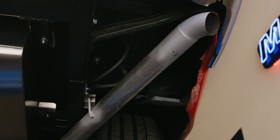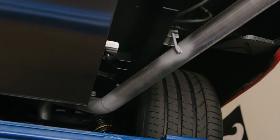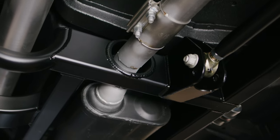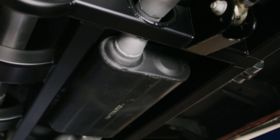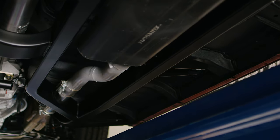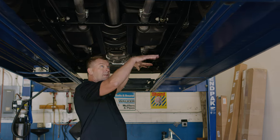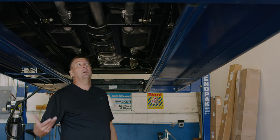During the conversion, putting the body on, we had to build a new exhaust system, and if you look underneath you can see how the exhaust is nicely routed — it goes right through our frame rails. The exhaust systems in these chassis tuck up nice and tight and neat, whereas with the factory chassis they tend to hang down, which could drag on a speed bump or whatever.